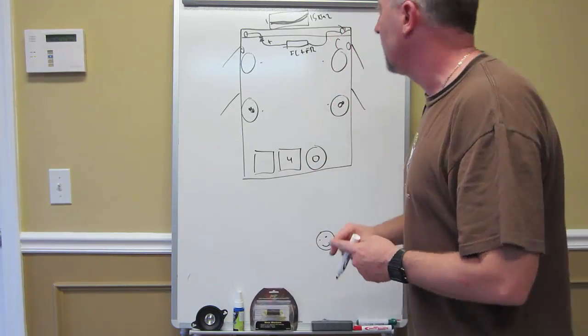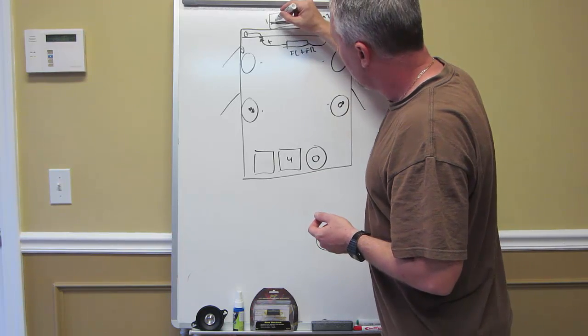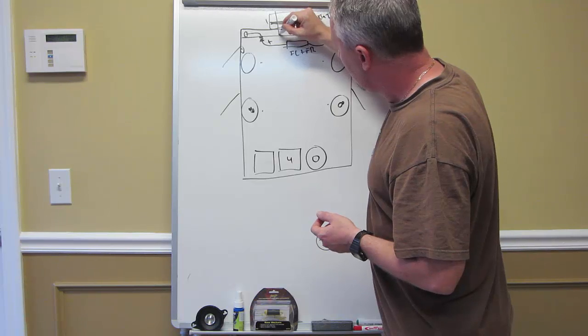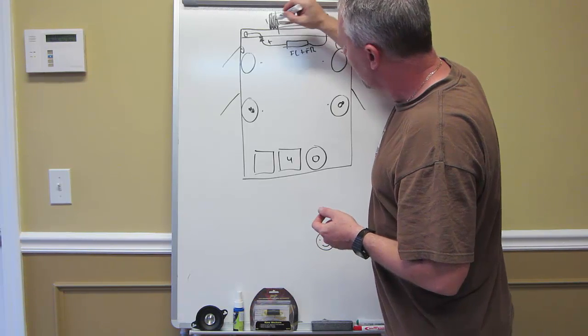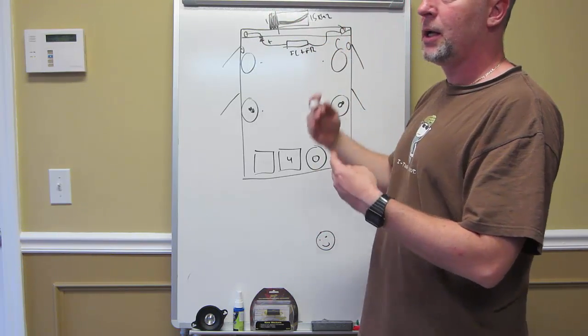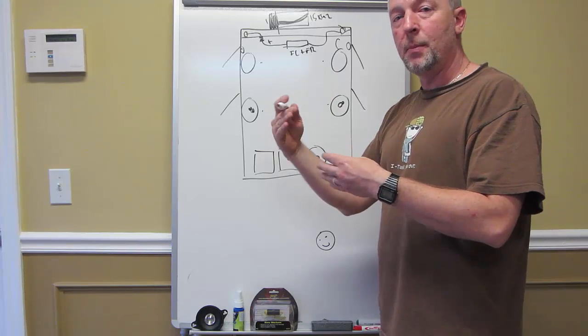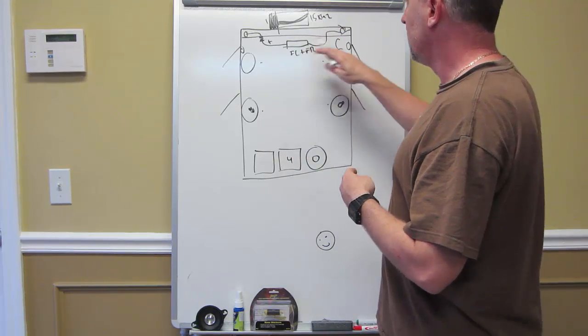800 hertz and lower. So again, going back to the sound spectrum, anything from 1 hertz up to about 800 hertz, all of this will be blocked out from these little speakers, allowing them to play 800 hertz and up, and all the destructive frequencies of 800 hertz and lower will be eliminated from it.